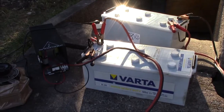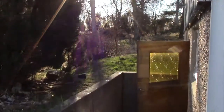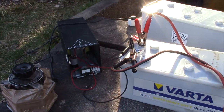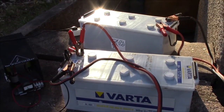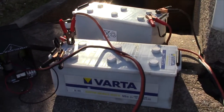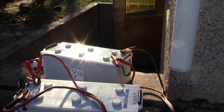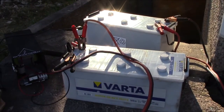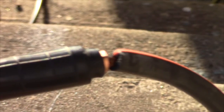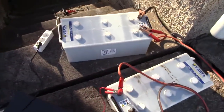The batteries have been charging for about 3 hours now and they're still drawing a healthy 20 amps. It's getting kind of late in the day, so I'm going to bring these inside. I'm going to try and let them rest for maybe 10 minutes or so and see what open circuit voltages we get after disconnecting the jumper cables, just to get a rough idea of how much they've absorbed. That one is probably not going to have charged quite as much because there's quite a bit of voltage drop in this very terrible starter cable.